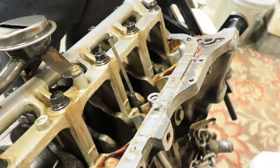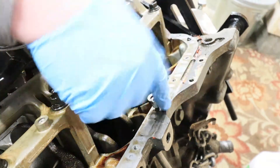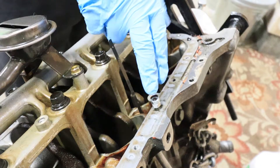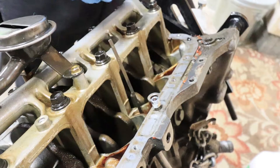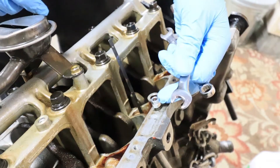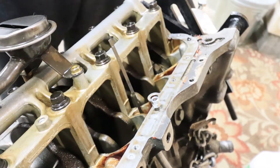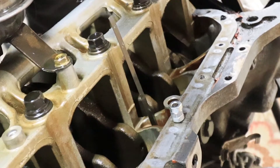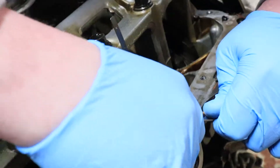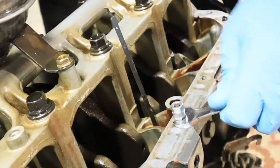This one's going to be a pain too. I don't know what it is with the middle stud on this side and this side, but they're both being a complete pain. So what you can do is stack up another nut there and that's going to add that much more surface area. I got three nuts stacked up there — let's torque it down and see if I can loosen this now. Boom. Just one more nut is all that one needed.